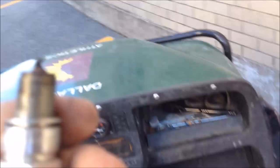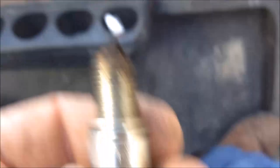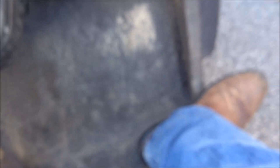If you have any questions let me know. I want to show you this old spark plug — see how cylinder number one is pretty nice and tan? But this is the cylinder that's the problem. You can see the deposits on the plug; you can actually see where it's bridged across there with contaminants.